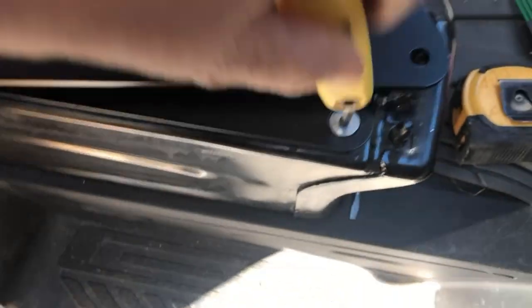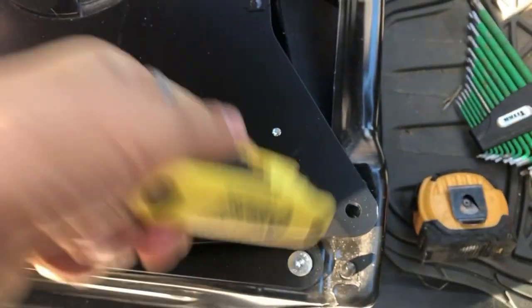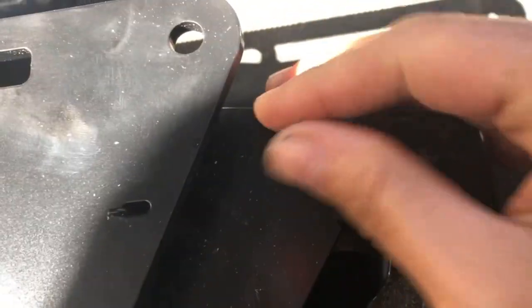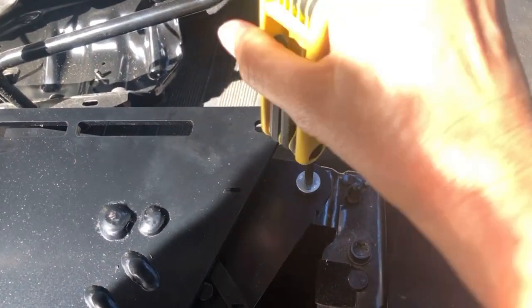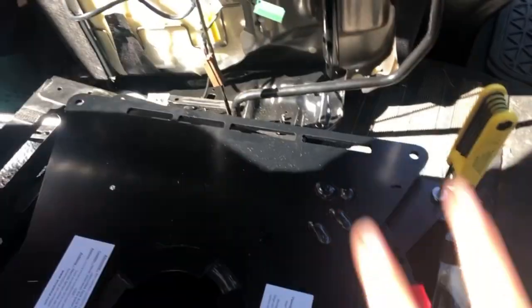You may need to back out your screws. If you tighten them too tightly, it's going to be hard to make fine adjustments for the positioning of the holes on the swivel over the holes on your base. Do not tighten your screws all at once. Keep them nice and loose until everything's in position, then tighten at opposite corners until they're all equally tight.